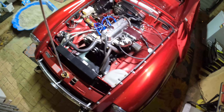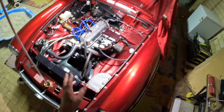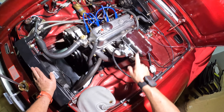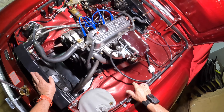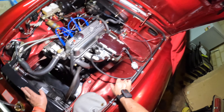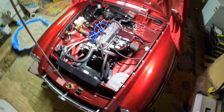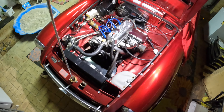This is now back on the road again, hopefully all well and good. Personally, I found better starting and better economy on the other MG with the Weber than I did with the twin SUs. I got the SUs right to a point but they just never seemed to work right. Whereas with the Weber I just put it on, set the idle mixture, set the idle speed, and it's done. If you want an easy life and just want to drive the car, that's fine. If you want to fiddle around with balancing and all that, that's fine too — it's your choice.